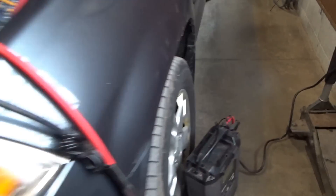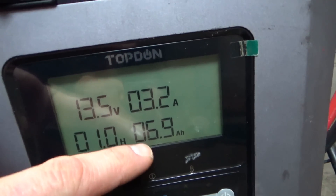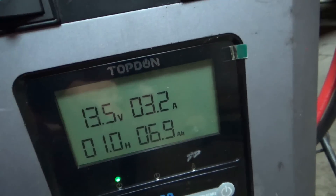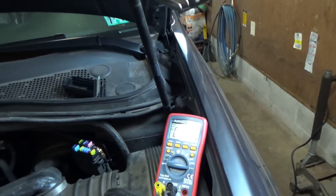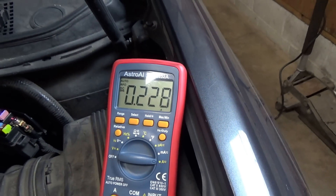It can't hold a charge. I put a charger on it and it only accepted 6, almost 7 amp-hours. A good battery should be like 80 amp-hours, and since it's fully charged, it's basically just being topped off right now. So, okay — battery's junk. Right after the failed start attempt, I turned the key off, closed the doors, and put the ammeter back on the battery. Now it's consistently reading 225 milliamps — not 16. So now we've reproduced the customer complaint. Basically this small draw together with a battery that's been fully discharged and charged — the battery capacity is junk. That's why it goes dead in 8 to 10 hours. Makes perfect sense. Now all we have to do is track down this parasitic draw.